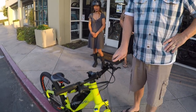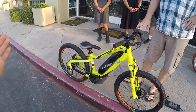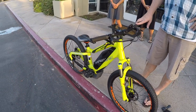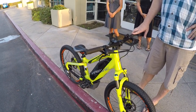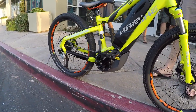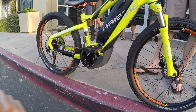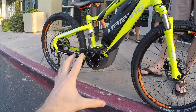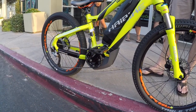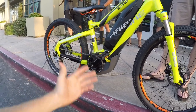Air forks are nice because you can adjust how full the air is, how stiff they feel, based on the weight of the child. Children come in all different sizes. The mid-drives are very efficient. It's a 36-volt, 11-amp-hour battery, and the motor is 250-watt nominal but puts out up to 80 newton meters of torque — that's even more than the Bosch CX motor. Yamaha is known for that zero-cadence immediate start. The cadence RPM is a little bit lower than Bosch — up to 100 RPM versus 120. You only have the S-Duro choice in this case.